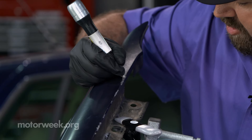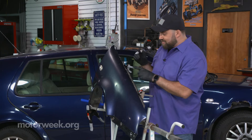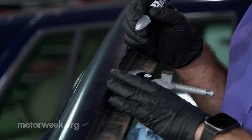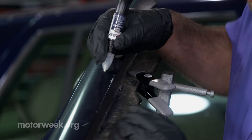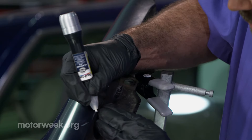It might not feel like it's doing much, but that is a very aggressive grit. One important thing to note is you're not trying to dig any paint out — you really want to just focus on smoothing the edges so that nothing is sharp. A lot of people use this and go to town, and it creates way more damage than what was there.